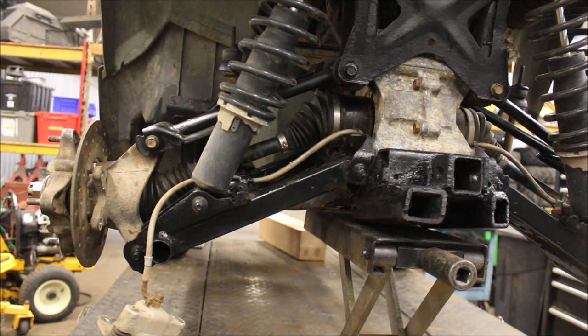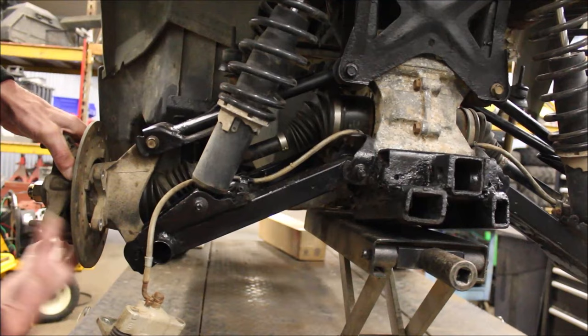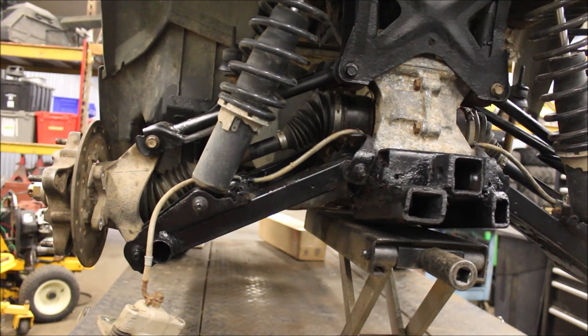Well, a lot of guys drive in turf mode constantly, and that puts a lot of pressure on one axle, which would be this one. So watch what happens when I spin this wheel, and watch this. Feel that. So immediately I thought, okay, there's gotta be an issue with the transmission. I did some research, and on a whim, I thought, well, maybe it's the splines on the axle shaft that are worn, but I highly doubted it.